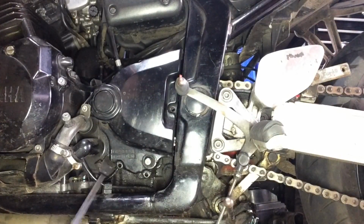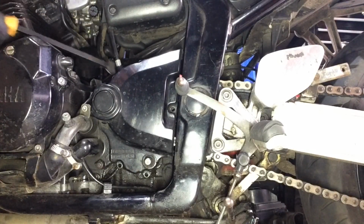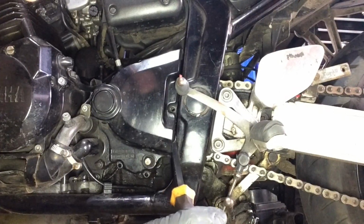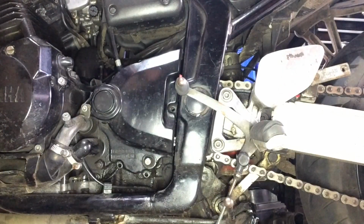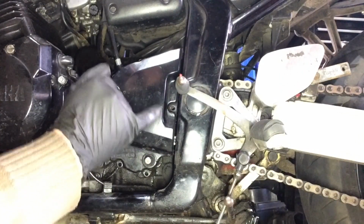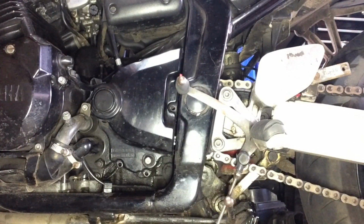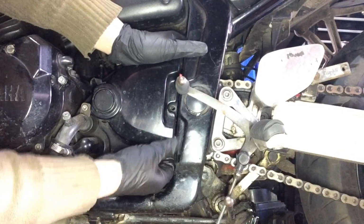If it doesn't want to move at all, then there's a good chance there is another bolt on this. By all accounts, I think that's absolutely solid. I don't think that's going to move. I think there is a bolt down there, but I can't see what sort it is. Right, just been doing a bit of searching and sourcing. Yes, there is a fifth bolt, but it's not recessed down in that hole. It's missing, so the bolt head should be right here. So clearly mine is just really stiff, so probably just going to need to give it a bit of a wiggle and what have you.